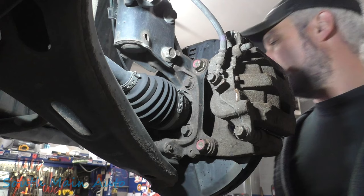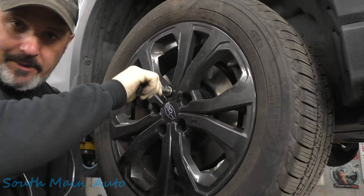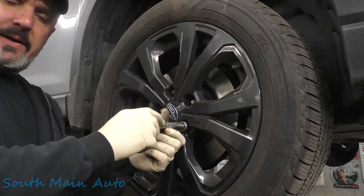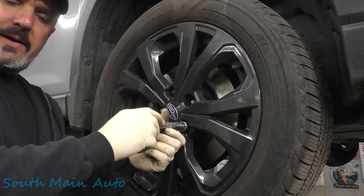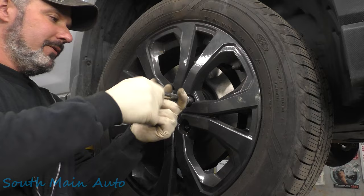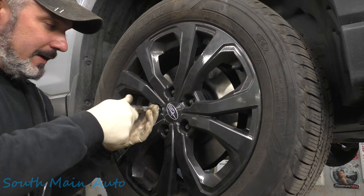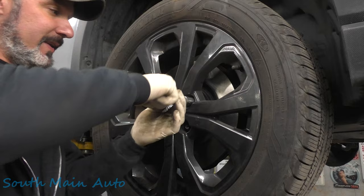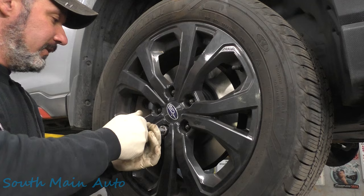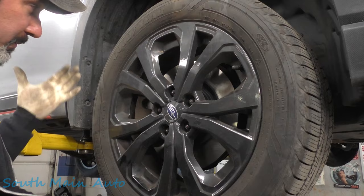Beautiful. Now this is going for a rep. We'll put the wheels back on before we go drive it. We'll pump up the brakes so we don't go slinging out into the street, then check our brake fluid and make sure it's full. Kind of curious — in the comments every time you do a brake job, everybody chimes in saying you should open the bleeder, you should empty out the reservoir, you should flush the brakes. I always look in service data to see what it says, and it's not too often in service data where they tell you to open the bleeder before you push the pistons back in. Same thing with Subaru — Subaru service data says remove the caliper body, replace the pads, put the caliper body back on, here's your torque specs, have a nice day.